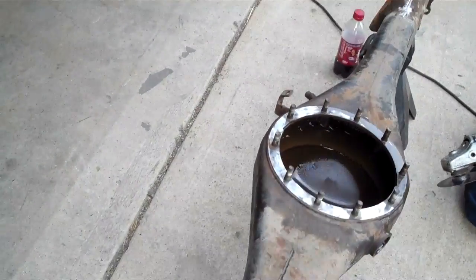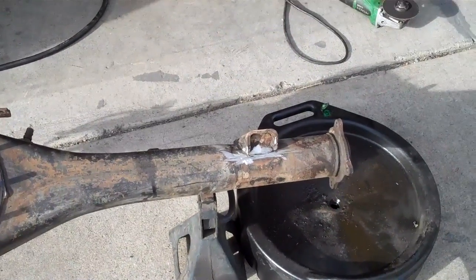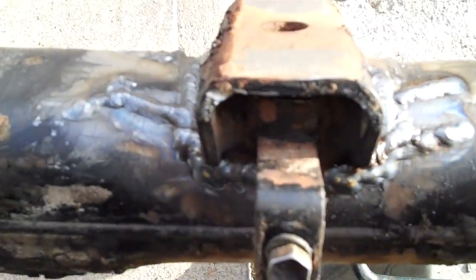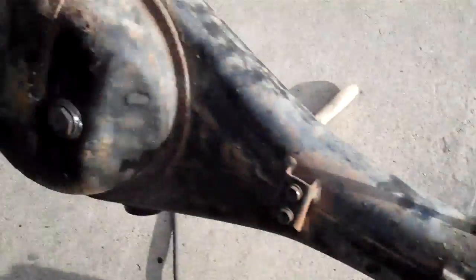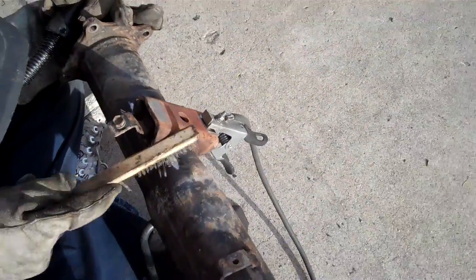We're about to get that taken care of. Did a bunch of cleaning on the inside of the axle — I know it doesn't look like it but it was horrible. We got it outside so we can do a little fire if we need to. So we've welded the crap out of this. We've done a little bit of practice welding and got that to where it's structurally sound. When we keep these sides up, we've cleaned them out with brake cleaner because it gets out of the way quickly — it's a little risky. So we'll be doing a little happy face on this. Like I said about Toyotas, they do not use the best steel. You can see on this one we've got it all completed all the way around — that's how it likes to crack with all of these little lines going to the outside. It had a great big crack across the base there — you can see where Spanky filled that in.